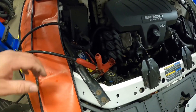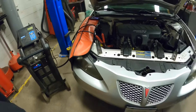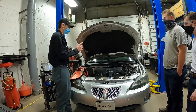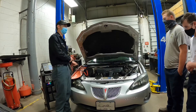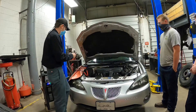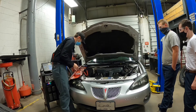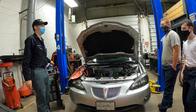It's always important to come back over and check a battery periodically. When we come back over, we're checking to make sure it's charging. On this machine it's going to tell you where it's at — pretty slick. If we're using a basic battery charger, we'd have to use a voltmeter — set to 20 volt DC — to come over and check it. The GR8 advanced diagnostic station is telling us right here, saves us that step.